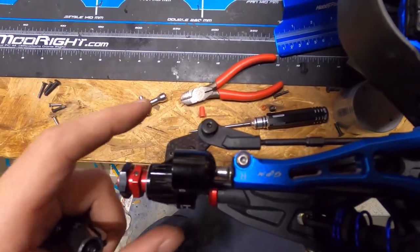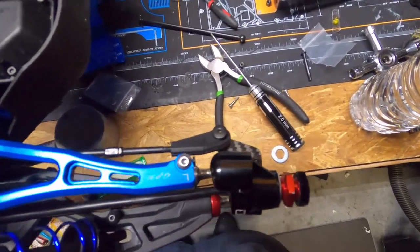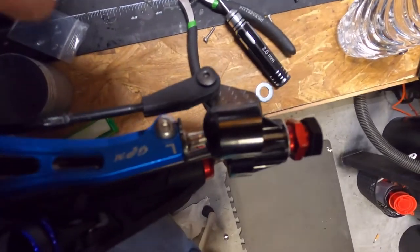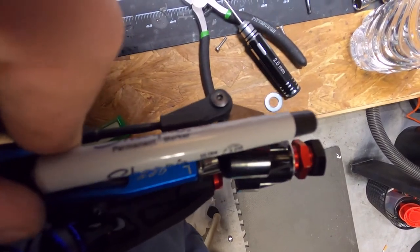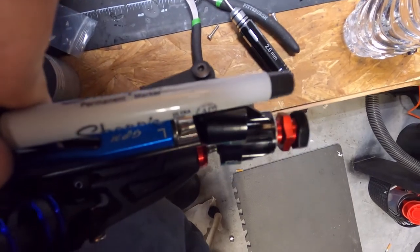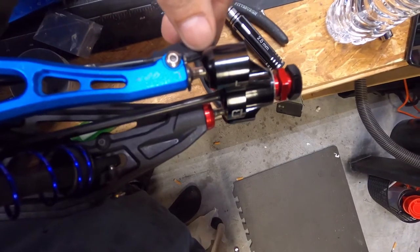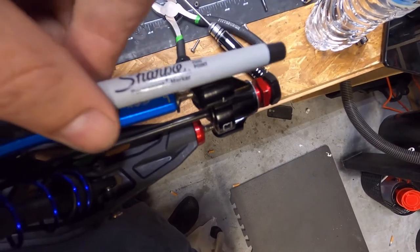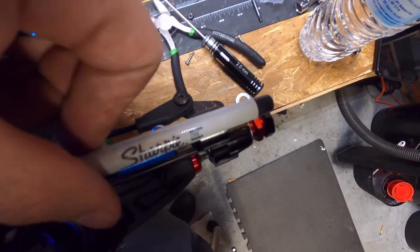This one side needs to be perfect. Then what you do is you go to the other side, and then you look at it. Let's take our pen and lay it across the line — see that the spindle is off. That right there tells me that it is not straight. So then you would want to adjust this, turn it in to shorten it, and then readjust it and look at it again — and now you can see that it is straight.